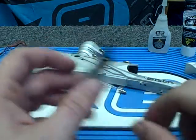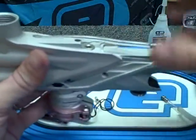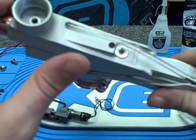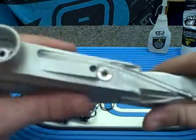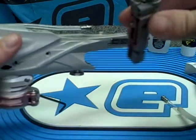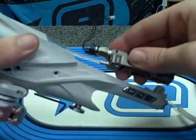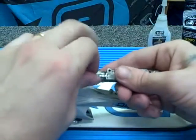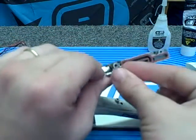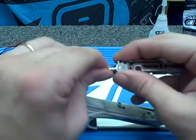One thing I found easy to do is replace the hose with the barb through the slot with a little bit of grease on there. Go ahead and place it like a torpedo down. Make sure you don't lose that screen in there either — that's pretty important. New barb with hose. Make sure it locks in place.